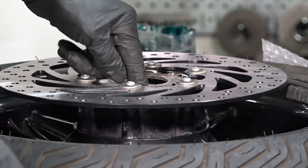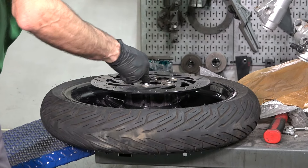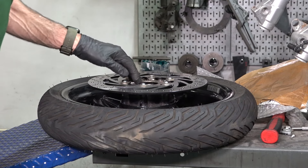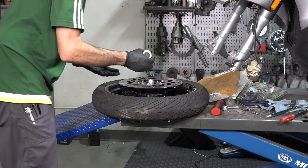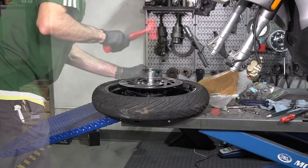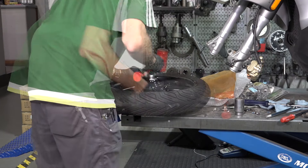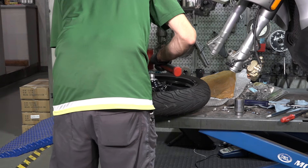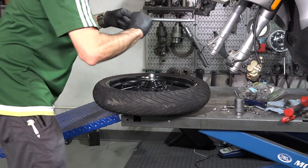So rotors are on there. Go ahead and put the spacers in. Before you even do the spacers, feel the bearings — they feel perfect. A little grease will help you out in there; it's not going to hurt anything, just a small amount of grease. They call it a dust shield and not a grease seal — a little bit different design than some motorcycles and scooters where they actually have an oil seal or a grease seal. So drop the cone on just like that. You're going to want to find a large socket that's the size of that and tap it back in place. Do the same on the other side. The axle originally never had any grease on it, but you could put a real light film of grease on it before you put the wheel back in.